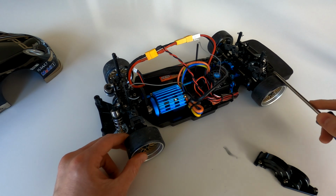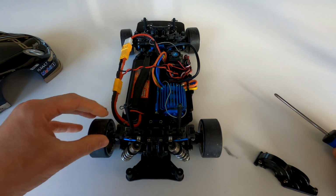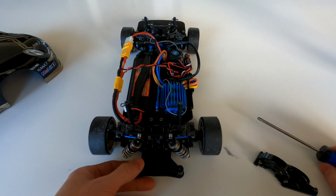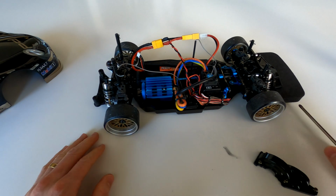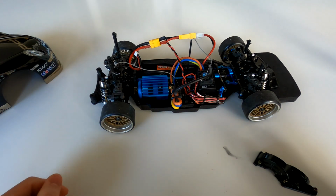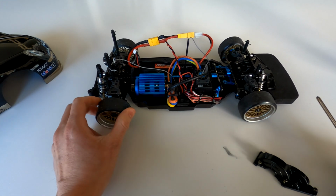If it's at 0 degrees, the tires won't wear out evenly. Eventually one side has more meat than the other side. But with about 1 degree camber, the tire will wear out more evenly, and that's really what you want, because it'll give you maximum grip for both front and rear. I mean, you can use camber to reduce or increase grip, but eventually the tires will be flat and just flush on the ground anyway. So really there's no point in adjusting. You don't adjust the camber setup like you would with a touring car. You just adjust it for tire wear, and you just want them to wear evenly on the inside and the outside of the tires.